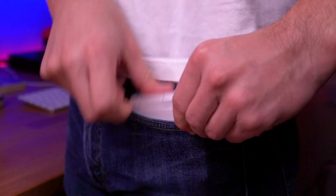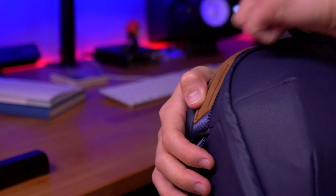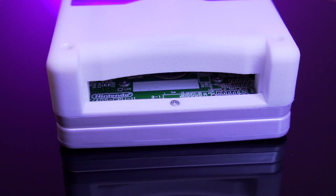Now let's get into the cons. The first and most apparent is the increased size — while there are some good things about this, the additional thickness does make the SP slightly less pocketable. To me it's a small compromise for all the added capability, and I typically just stow it in my backpack. Another con is the relative difficulty of this mod — there is a lot of wiring that requires some fine soldering skills, making it less accessible. There is just a mess of wires, and in hindsight magnet wire would have been easier to close the unit with. Lastly, this is still a work in progress: there are key things missing such as the absence of an RF shield which leaves the motherboard exposed, the lack of an audio jack, and the overall fit and finish needs to be refined. Both Kyle and I will keep you up to date on this project.